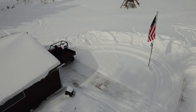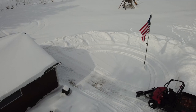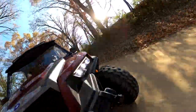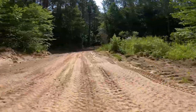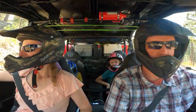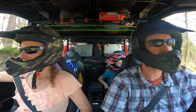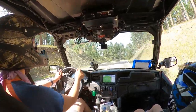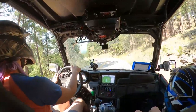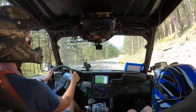At the end of the day, I've found that the bias ply tires on our Ranger work great for operating at lower speeds, doing utility work, crawling over logs, and really nasty mud. But for high horsepower, faster machines, I think radials really provide a better riding experience and better performance. That's exactly why we chose radial tires for our General — especially riding with the family for longer distances on hard surfaces or pavement. A harsh loud ride for long periods is going to wear on you as a driver and make your family enjoy their time in the side-by-side a lot less. Trust me, after a windshield, picking up a set of radial tires is probably the best thing you can do to improve your family's enjoyment in the UTV.